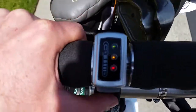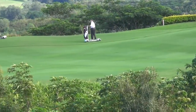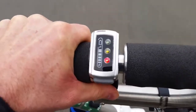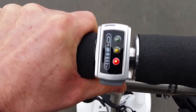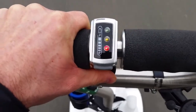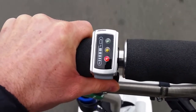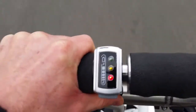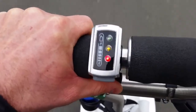The GolfBoard typically has a range of 10 to 11 miles at full speed, more than double the distance of most golf courses. When the battery is depleted to just 25% charge remaining, the speed will automatically reduce by 50%. At this time, only the red LED light will be illuminated on the stability bar and remote LED meters, and the board will have 1 to 2 miles of remaining capacity, which is sufficient to complete several more holes.